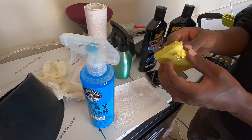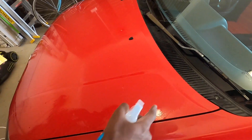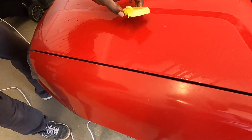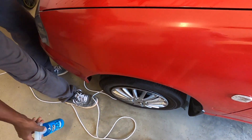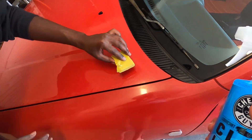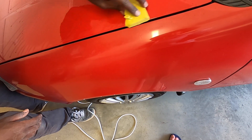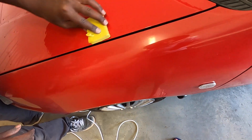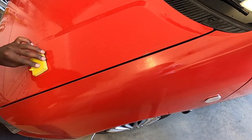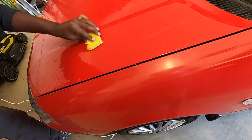We're not gonna use gloves. I sprayed this lubricant — I'm just gonna do this area and then we can see if it makes any difference. It's just a lubricant to make it smooth so it doesn't scratch the paint. Chemical Guys brand, got it from Super Cheap. Now we're just gonna pass the clay bar over. Can you feel the roughness? I can hear it.